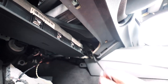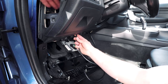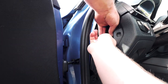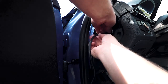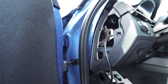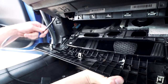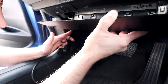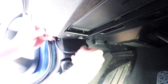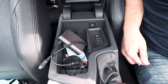Route the cable completely out of the way of the airbag. Connect your OBD2 extension, then route the other end up and through the panel. Get a zip tie, loop it through the piece of metal and loosely over your OBD2 extension to hold it in place. Route your OBD2 cable down and away from the airbag. There's a small cutout — put it through, line everything up, plug in the OBD2 extension, and tuck any excess wire back up.